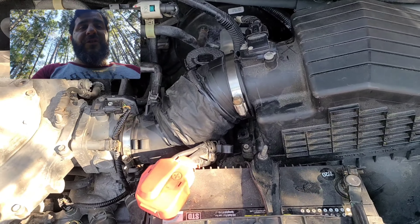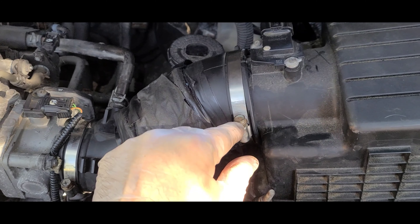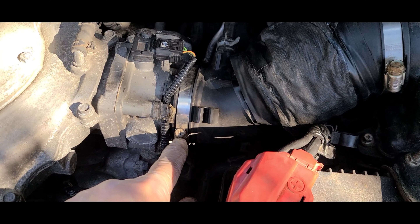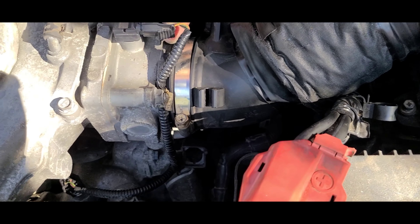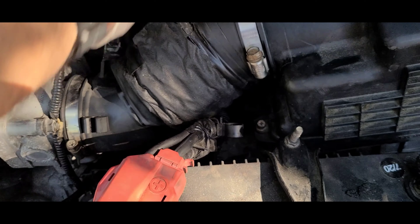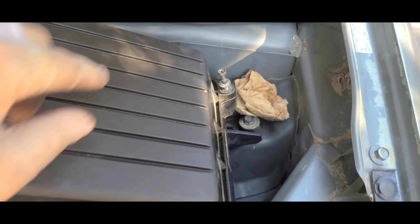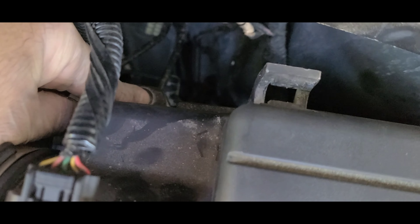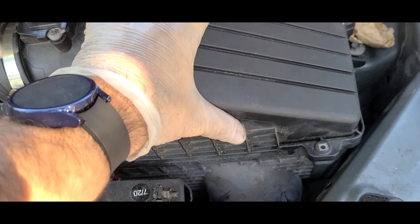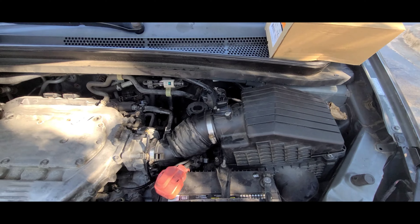Let's get it rolling. We have to loosen up this with a 10 millimeter right here, and there's another one — 10 millimeter. If you want, you could take this off. Take that off the EGR — if you want you could take it off. You could unscrew it; there's one over here, over here, over there, and one right over there. See it right here — just unscrew that, easy for you to take it out with this piece out.